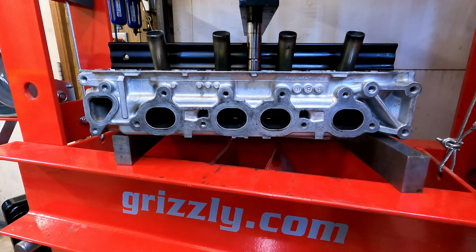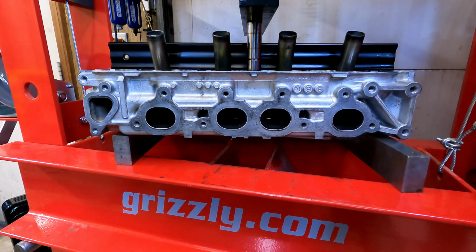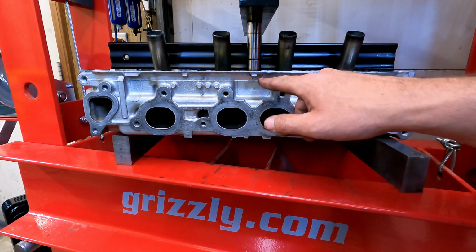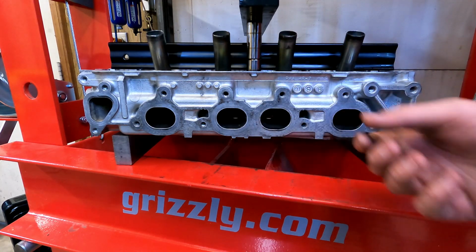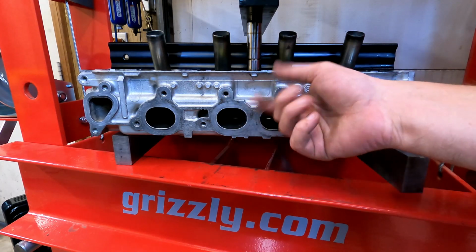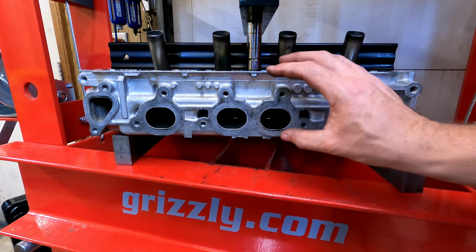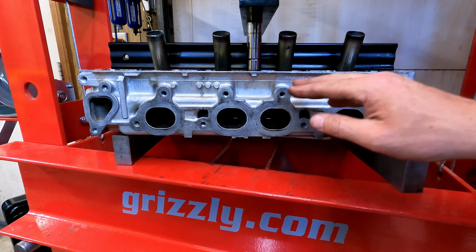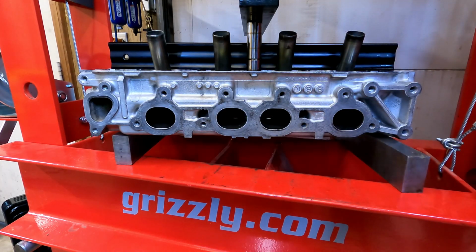And what we're going to do is, using a cutting torch, without using the cutting part of it, just the heat part of it, we're going to heat up in the webbing here where it's thin until it just starts to melt, and then we're going to back away. And what that's going to do is it's going to relieve the stress here, and then it's going to re-solidify. Thus basically holding the pressure that we've applied to it here evenly, and releasing that bow that it was locked into as it was overheated.